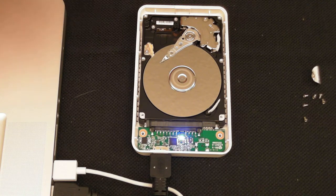Well, it stores all the bits and tracks on the rapidly spinning platter. But as you can hear, it's having some trouble actually doing anything. So what's it doing to the bits? It's not actually touching them. The heads are flying a very, very small distance over the platter. If I pushed down on it a bit, it would probably make a screeching sound and fly apart.